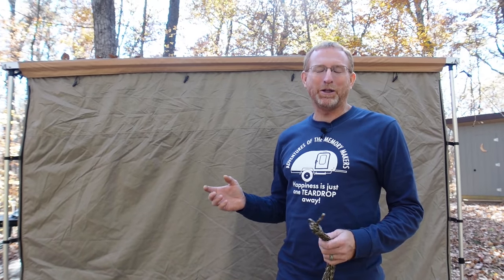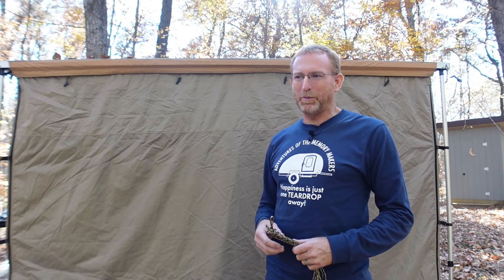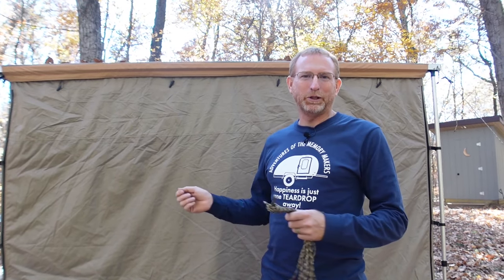On some of them, especially ones I haven't done before on a different style camper or room, I may have this room on and off that track two dozen times. One thing that has frustrated me over the last year or so is putting this up by myself. If you've ever put one of these up by yourself then you know what I'm talking about — you're trying to push that bolt rope through that keder slot on the frame rail. You're pushing a little bit, going to the other end, pulling a little bit, going back, pushing some more. It's just frustrating, especially when you do it two dozen times. I'm proud to say I found a way to fix that, though I feel stupid it took me a year to figure it out.